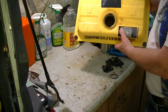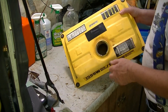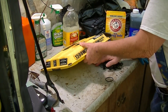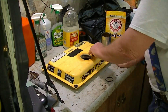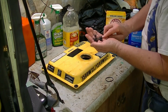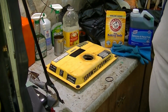Here's a tank — this happens to be a little generator tank, not a motorcycle tank, but it doesn't matter. I don't know if you can see inside but it's got plenty of rust. We're going to seal off the opening with Gorilla tape — clean the metal and get it on there real good — and take your petcock out and seal up that hole. We're going to put sharp gravel in here. People like to use nuts, which aren't as sharp but have the advantage of being magnetic if you don't use stainless ones. Your choice whether to use really fine gravel or not — it tends to get caught and be hard to get out.